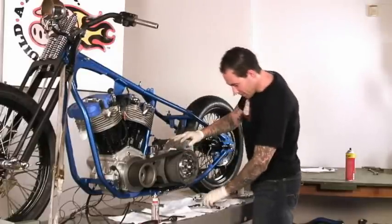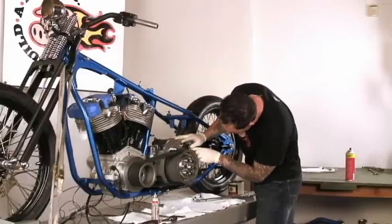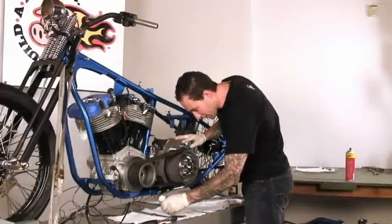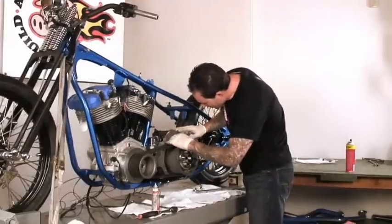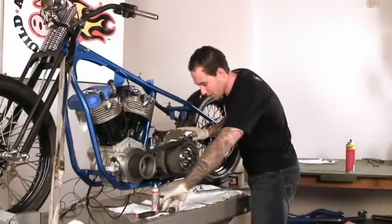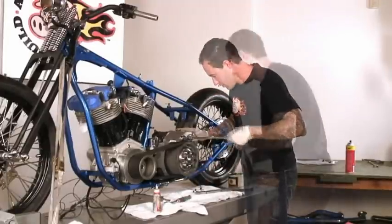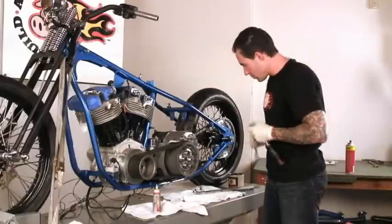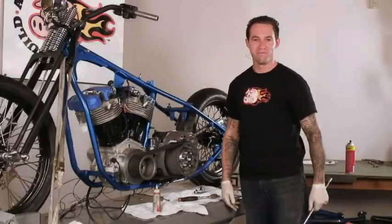The tip of the jack shaft will be sitting in it at all times. Mount that. And then I'm also going to use this bracket for our license plate frame. Put a couple drops of blue Loctite on our mounting bolts. And we'll spin these guys into place. And we'll go ahead and torque these down to 10 foot-pounds.